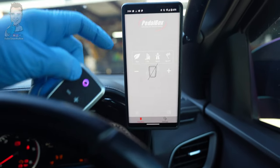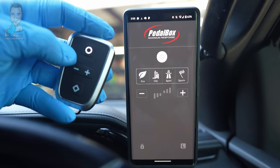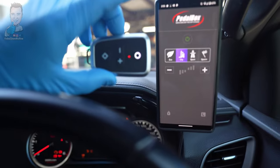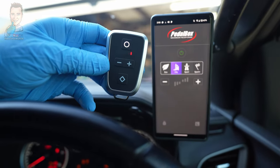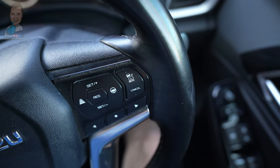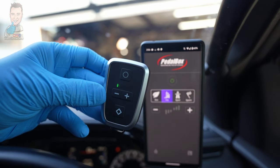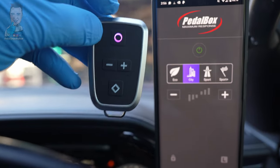Once in accessory mode, the module wakes up and goes purple indicating it's detected. On the app we can see we're all connected. To get into Perfect Tune mode, hold down the plus and minus buttons for about three seconds. The app will say we're in tuning mode — we then slowly press the throttle from neutral to full throttle, press it all the way down and release, doing that a couple of times. You can see on the app how it reads the pedal input. Do it a few times nice and slowly, then hold the program button at the top for about three seconds until the lights go off — and you're all tuned.